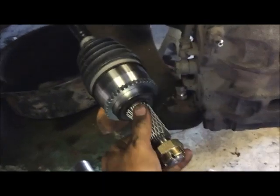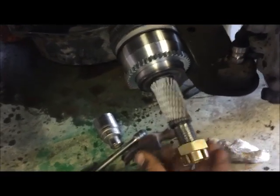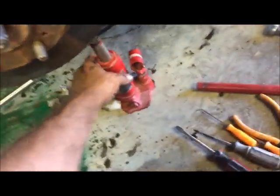She popped in twice, so now I can remove the nut. I always like to leave that little collar on there so I'm not bumping the threads against anything while I'm working. Now we can pull that off — that's just to protect the gears. I'm going to bend her around and pop her back into the axle. She slid right in there. My knuckle here is not quite lined up, but the lower control arm can flex a little bit, so just maneuver it around.